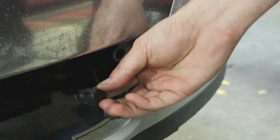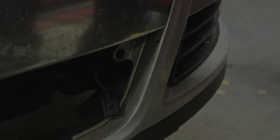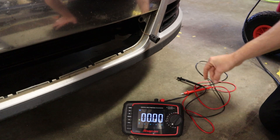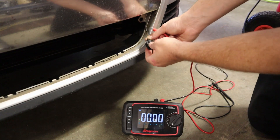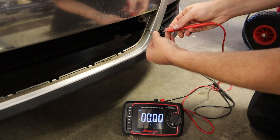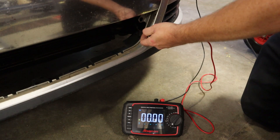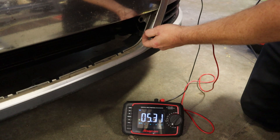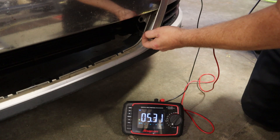That little tiny sensor — let's get our meter and see what voltage is going to this plug. I have my meter here; it's a Snap-on, but you only need a $35 meter to do this. I'm going to put my probe on the yellow and brown wire, set my meter to voltage. I should be getting about five volts with the key on — the car doesn't have to be running, just key on. Right there it's showing 5.31 volts — that's actually good. So we're getting the voltage to this plug, which tells me we probably have a bad sensor.